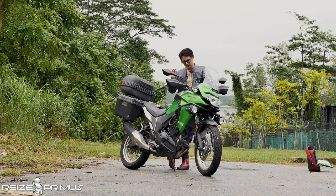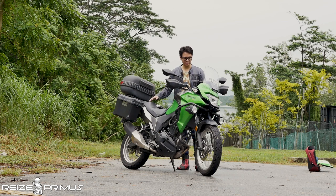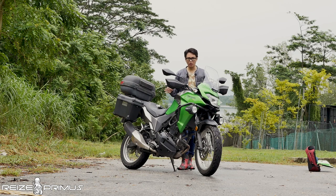When I say it's good for the street, that's pretty obvious because the X300, despite how it looks, is actually using a Ninja 300 engine — an entry-level or mid-level sport bike engine in our country. The engine is tuned a bit on the lower end to give more power in the lower RPM range compared to a Ninja 300, but it's still the same engine.